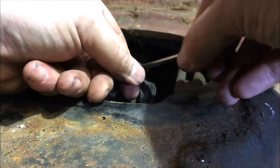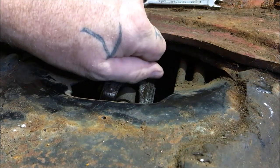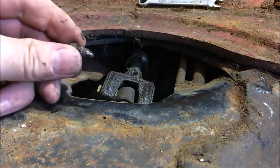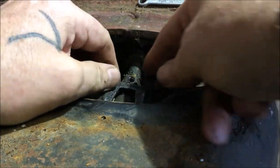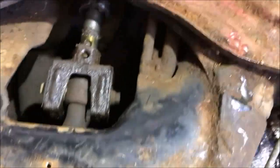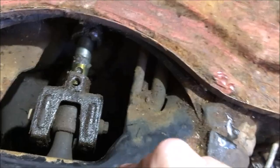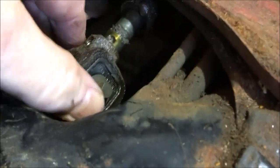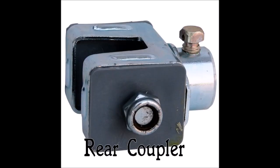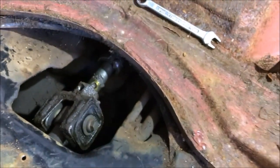It's going to be stubborn — it's been in there for a while. Here's what the bolt looks like; it's a kind of odd bolt. Put it somewhere safe so you don't lose it. Once that coupler is pulled back, this shaft will slide right out when you pull the transmission. Here are the other bushings I was talking about — there are rubber bushings inside here. You can buy this whole new coupler; it's very easy to change and it'll tighten your shift up too.